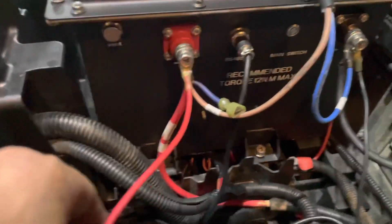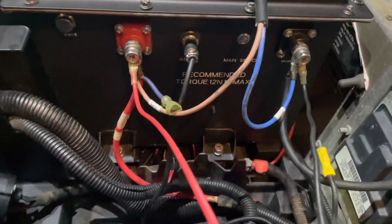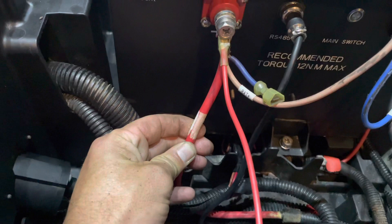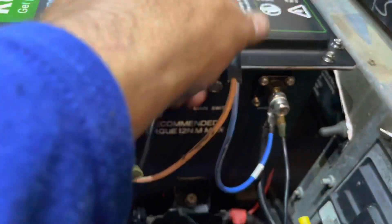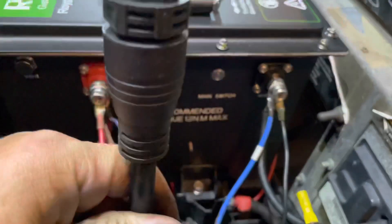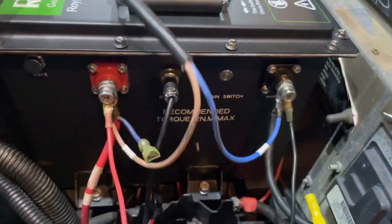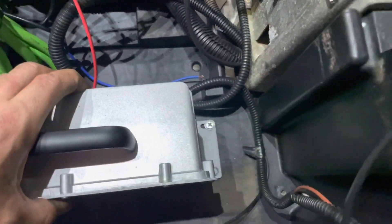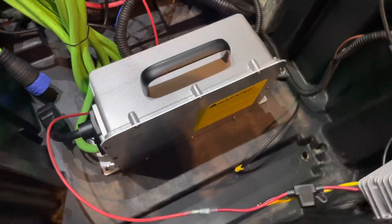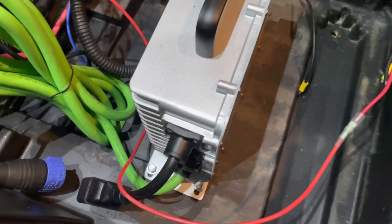Here's what I have hooked up to my terminals: I have my positive and negative for my 12-volt reducer. I also went ahead and installed the onboard plug for the charger, so this charger will mount onboard. I went ahead and mounted the charger in this open space right here — this is about the best space to put it so you don't hit anything on the bottom if you're using self-tapping screws like I did.